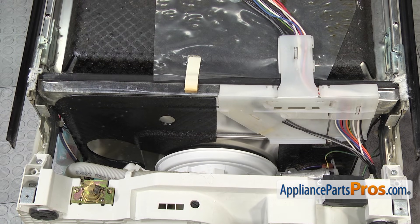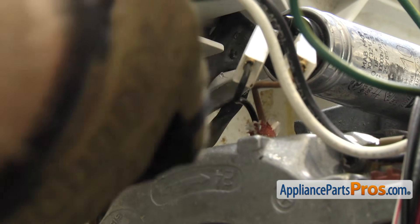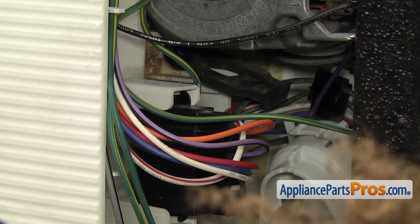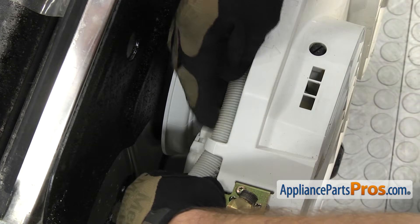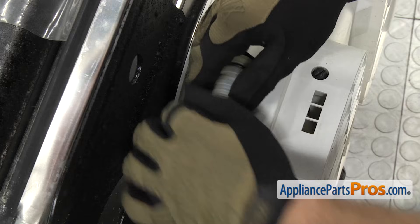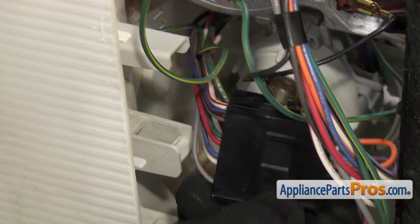Now we can take off the straps that hold the circulation motor in — they're located in the front and the back of the motor. We're going to reach in with a flathead screwdriver and get this black strap off this white post. Once you have the front one off, we can go down and take the back one off. Now that we have the rubber strap released, we can come to the other side of the pump on the left side and we have to remove this hose — take it out from underneath this locking tab and then pull it out of the sump. Now that we have the hose off the sump assembly, we have to give a little slack in the wiring harness, so we're going to pull this black block out of the base. You don't want to disconnect the two halves, just pull it out of the base.